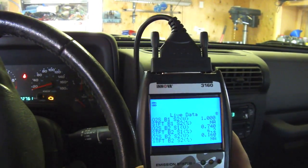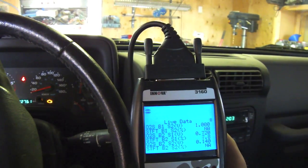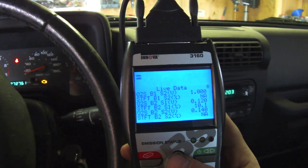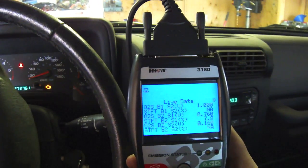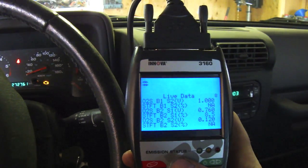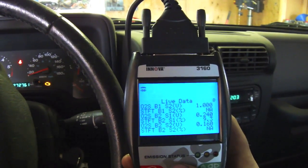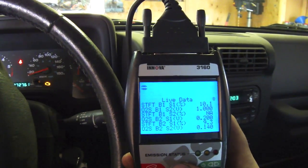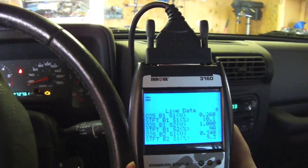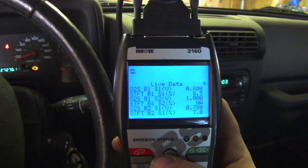That is systematic that your O2 sensor has failed on that one. That O2 sensor is the one that monitors your fuel mixture after the main O2 sensor, because bank one sensor one is the one that actually mixes the fuel. So bank two sensor one and bank two sensor two are both jumping around, and bank one sensor one is jumping around — but bank one sensor two is staying constant. That is making me believe that sensor is faulty.